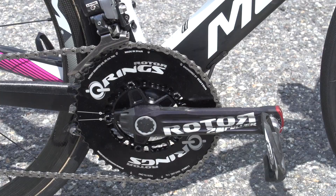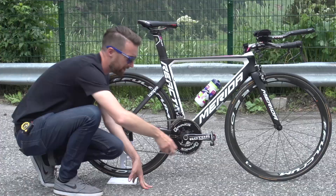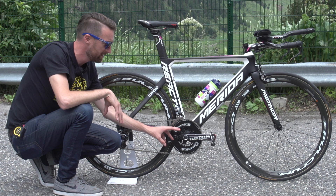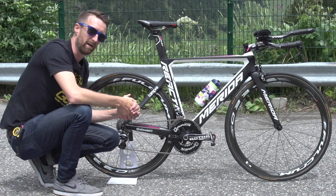The chainset is provided by Rotor and it's got their two-in-one built-in power meter as well. The chainrings are Rotor Q rings — so, as you can see, slightly elliptical. He's got a 53-tooth outer chainring, which is standard on road bikes but slightly smaller than you might expect on a dedicated time trial machine, and the inner one is just 36 teeth. That will enable him on these time trials to go very fast on the flat and the downhills, whilst being able to get a nice cadence going on the nastier parts of the course.